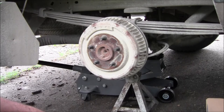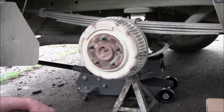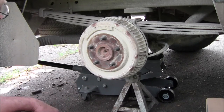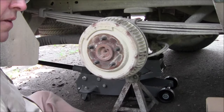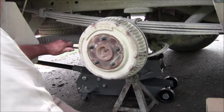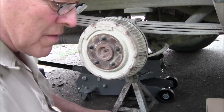When you do the brakes on your old Chevy, they want to know the diameter — it's basically a 10 or 11 inch drum. I had to pull the wheel off to tell them. If you're not familiar with these, they have the maximum diameter stamped on them: it's 256.3 millimeters, which works out to basically a 10 inch brake drum. Let's see if we can get that baby off of there.